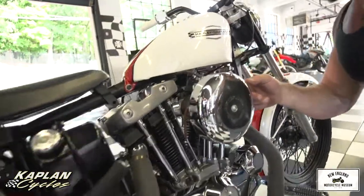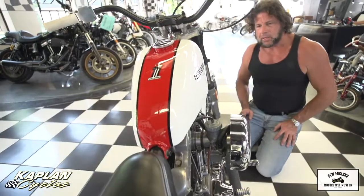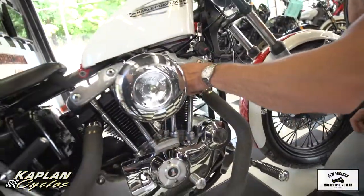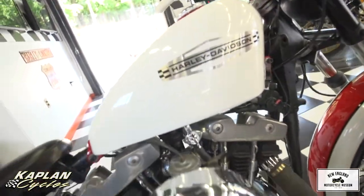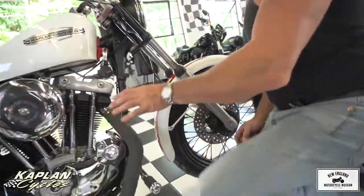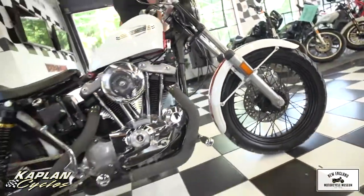This is an original Screaming Eagle Harley-Davidson air cleaner mounted on a Mikuni carburetor. This is what they put on the XR750 — the XR750-style Mikuni carb with the Branch heads intake. The intake is by Branch, the carb is by Mikuni, the air cleaner is by Harley-Davidson. Brand new petcock, brand new fuel lines. Engine is on point, in perfect condition — 150 psi per cylinder.